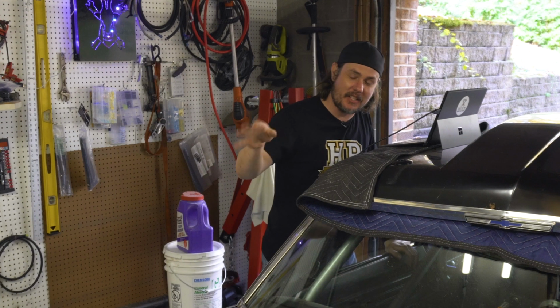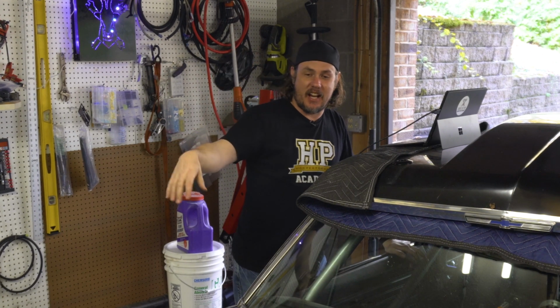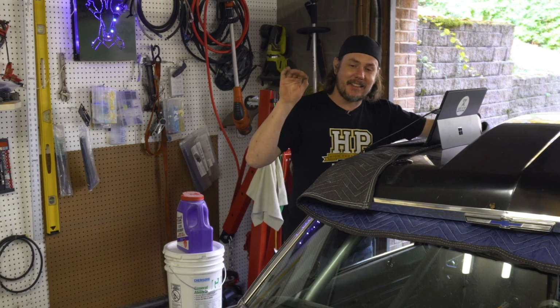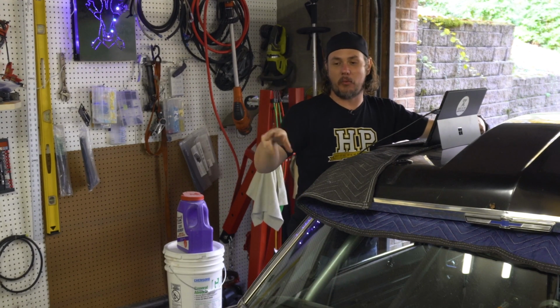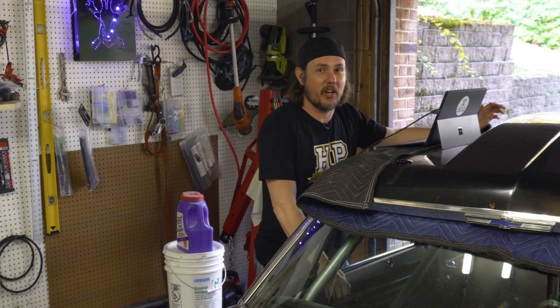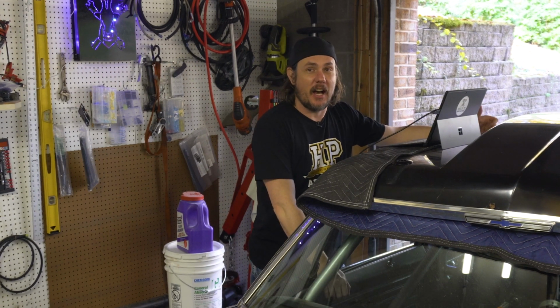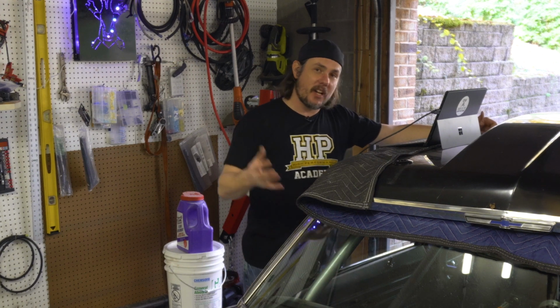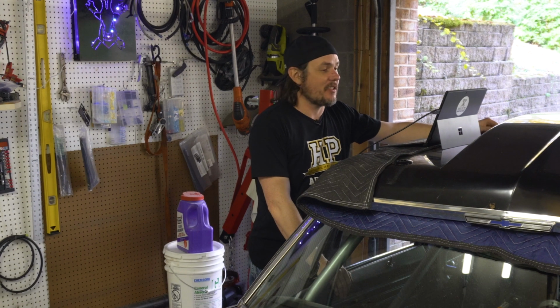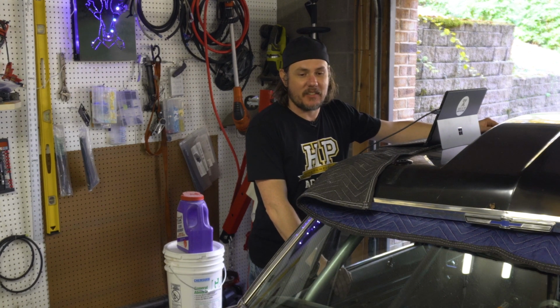But that's with the headlights and the hazards and the radio on, but that's also not with the electric fans running, which both of those are going to be pulling, you know, another 10 amps or so, maybe even a little bit more. So we're talking about 70, 80 amps is what this thing is drawing at idle. So it's definitely a power hog.